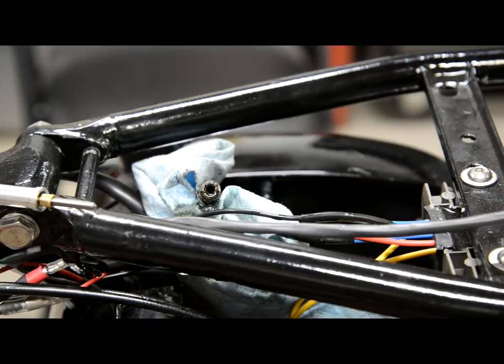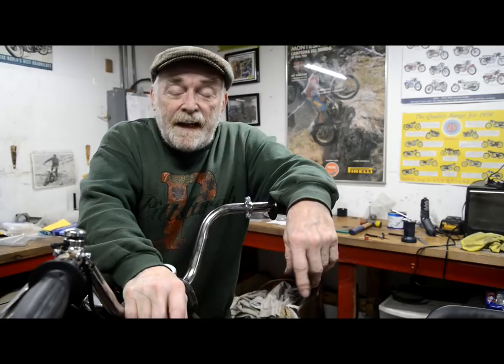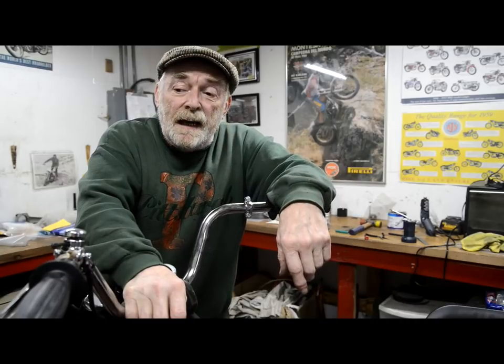I kicked this till I was blue in the face. And then I took the, hang on a second. All right, that's a little bit better manners when I'm talking to you. So as I say, I was kicking and kicking till I was blue in the face. And then I took the oil feed and the return line off the bottom, and nothing was happening. My first thought was, oh damn, there's nothing coming out the return, I'm going to have to take the pump off and this, that and the other. But then I noticed it was bubbling at the other side, and I thought, wait a minute, let me check on this. So I looked in Rupert Ratio, and that's when I found out that these early engines, you don't cross the oil lines.